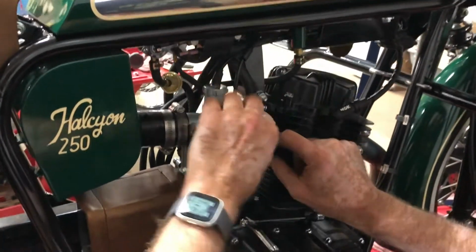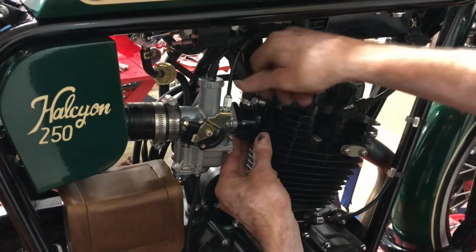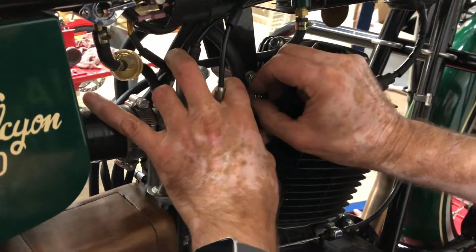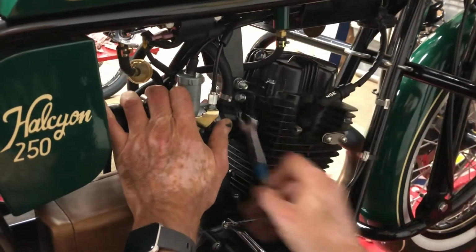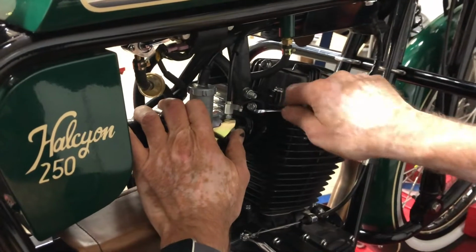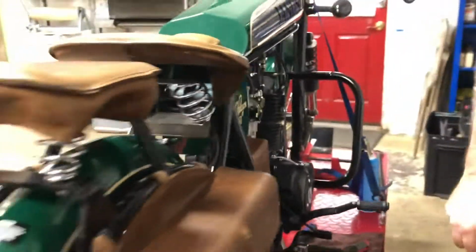And because the hose clamp is in the wrong place here, it gives us some problems with this bolt. So this one's a little harder to get everything positioned back. There, we got that. Okay, now when things get lined up, you can get this bolt started. We can go ahead and tighten this bolt back down. And again, these are small bolts going into aluminum, so you don't have to crank on those very hard. Go around the other side where you can get the bottom one.